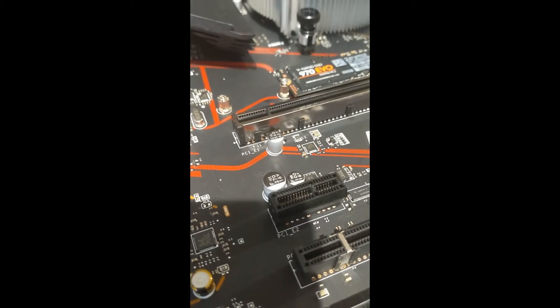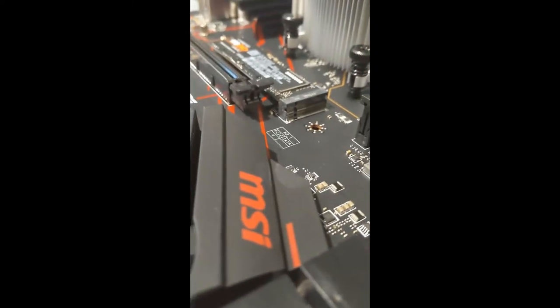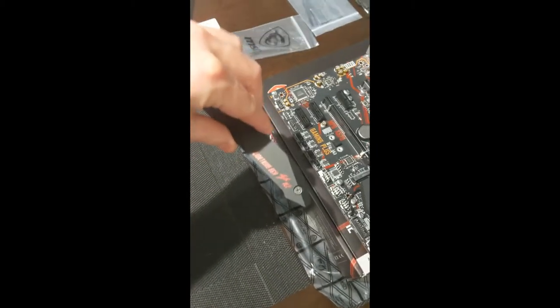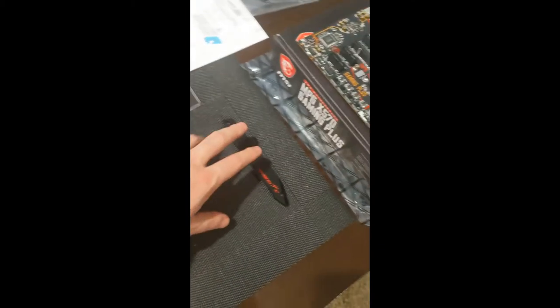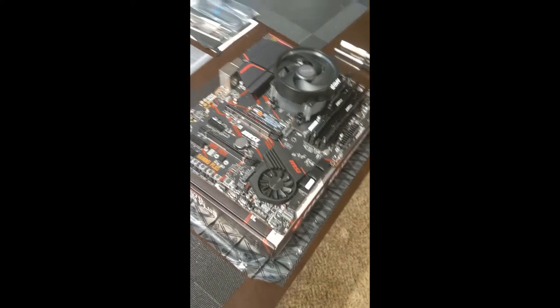And then I had to use the motherboard came with this crazy elevated heatsink thing that it basically sits on. So this M.2 actually has like half a centimeter of clearance from the board. What's crazy is that they also include this super heavy duty heatsink for it. The only thing is that it uses this as where one of the screws goes in, and that happens to be one of the standoffs for having it go into my case. So I can't actually install the heatsink until I have the motherboard in the case. A little weird there, but you know, it is what it is.